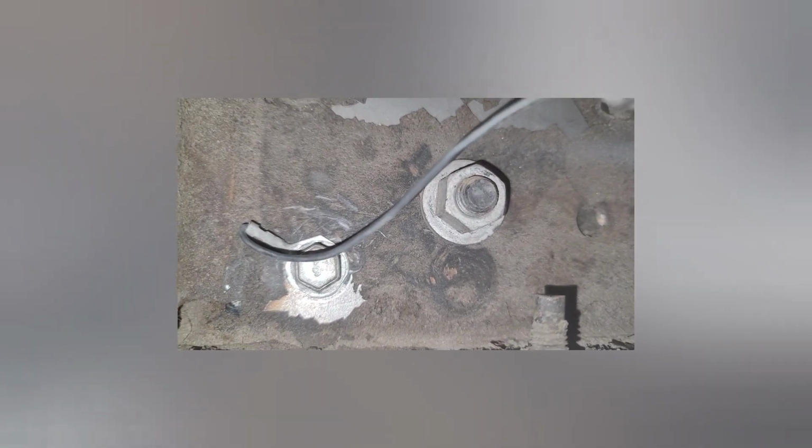Other side's the same. And also you see right here that 13, this is like the ground strap with a 13 on there somewhere. There it is. That ground has to come off. Same thing on this side. Oh, you can't see it as well. The harness is in the way, but there's another 13 ground. You disconnect this connector right here.